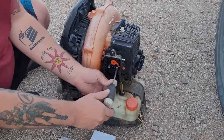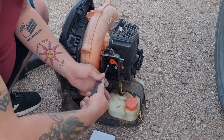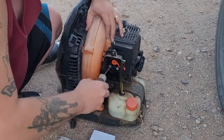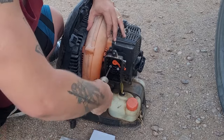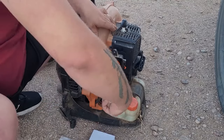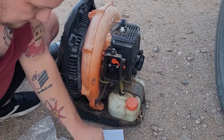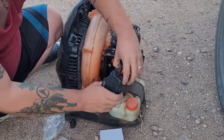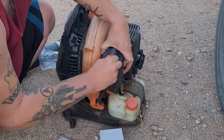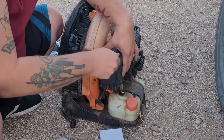I like to go one side a little tight, the other side, match it up, then go back and finish that side — all the way tight. No need to overwork yourself and destroy it; just a little past hand tight will work. Put this new air filter on, remove the old gaskets, put the new ones on, and put the filter in just like that. Make sure you're putting this back on right.